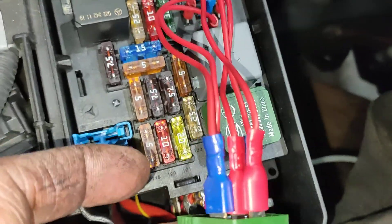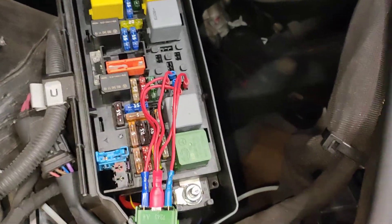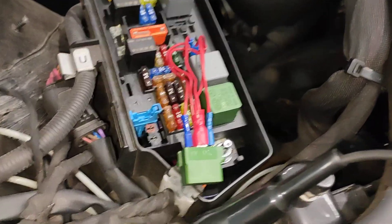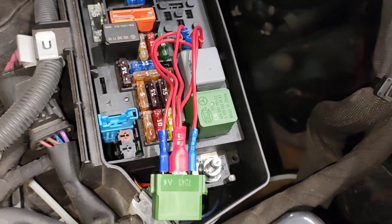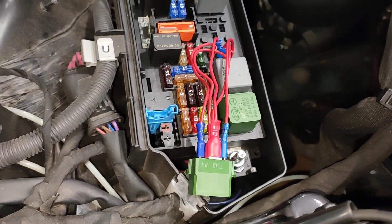I had to wire this one up like that because I need to confirm if it is the actual air compressor. I can't just guess — I have to make sure it's in black and white. So I replaced the relay last week, and every time I start the car, the compressor will cut in and then the car will turn off.